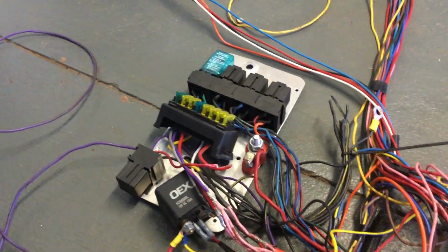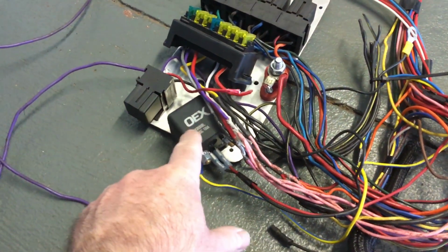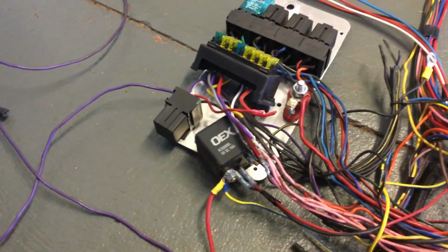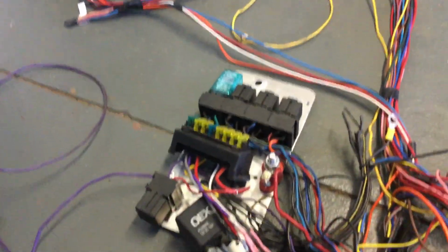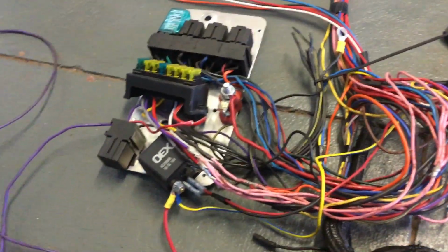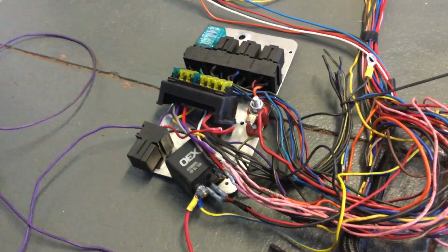To compound that, where I've tried to first aid the car is replace the ignition module relay with 100 amp, because the power for this ignition system was never done directly to the battery. It was done from a relay here back to the post, and it's getting the power to the post from that pull thing, and then started back to battery. So the power for my ignition system was severely compromised. It should have had the power taken direct from battery as per instructions, but once again it was missed by the rewirer.